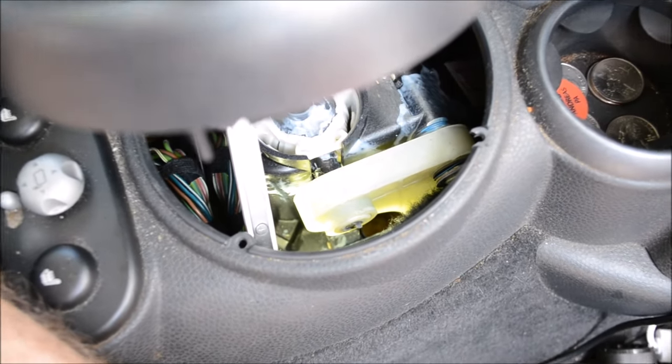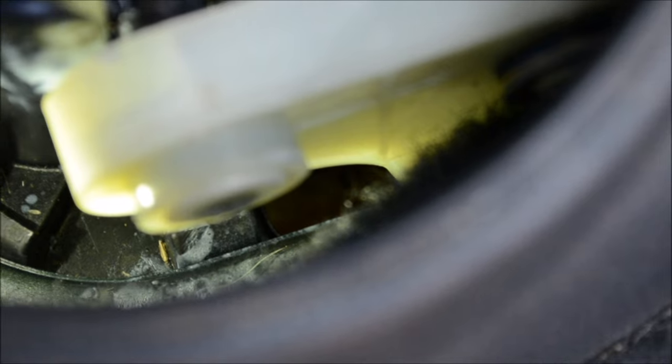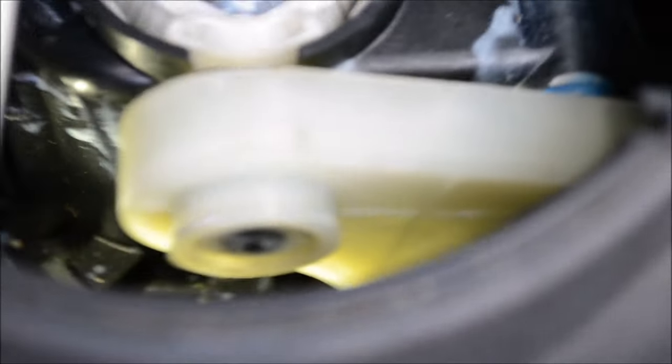You want to come in here and see down in there. You can see past the metal lip into the rest of the shifter assembly. There's a joint down in there that you want to spray. See that ring there? It's going to disappear when I let go of the shifter. I'm just pushing the shifter over like that so you can see it, and you'll want to spray that area.